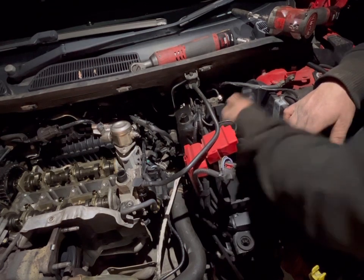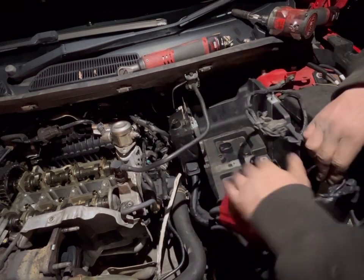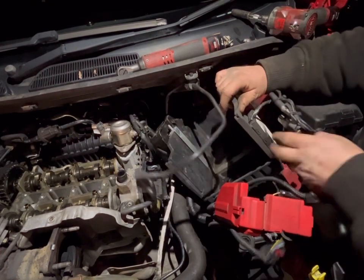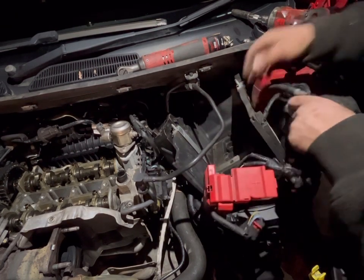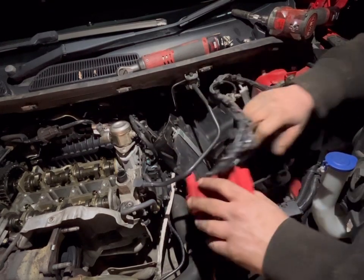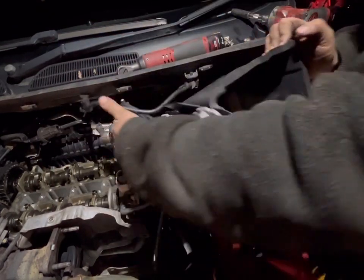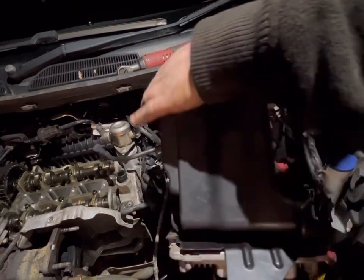What I'm probably thinking is once you've got to this point, the battery tray is down at one side, which is by the ECU. What I'm going to do is — there's an aftermarket tracker or something on the side here, which is never ideal because that's hindering us getting to where we need to get to. I'm actually going to move this out of the way just enough so we're able to get to the starter bolt.